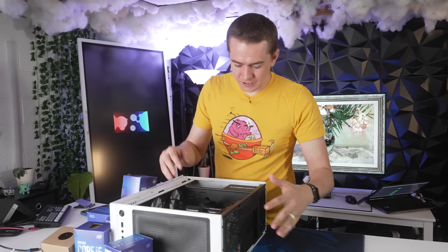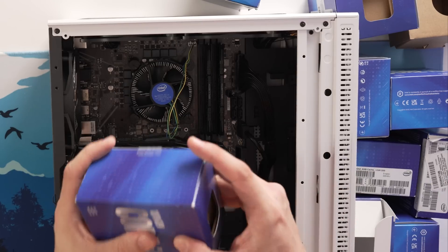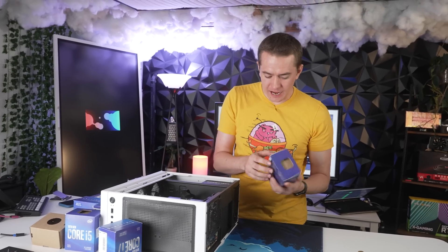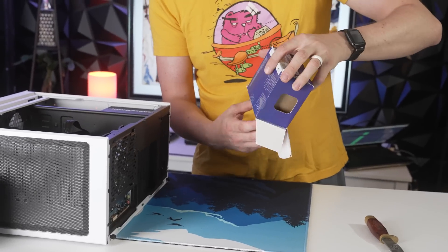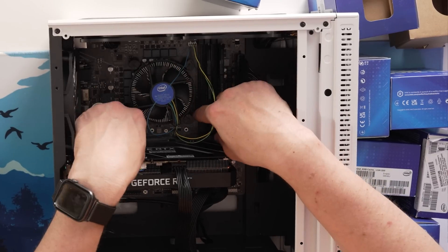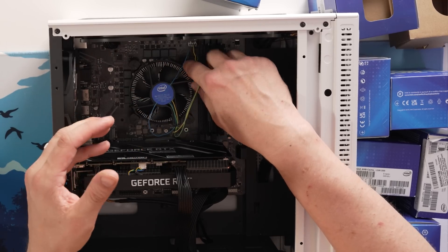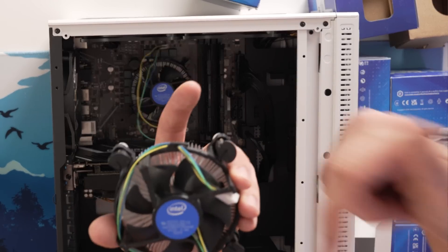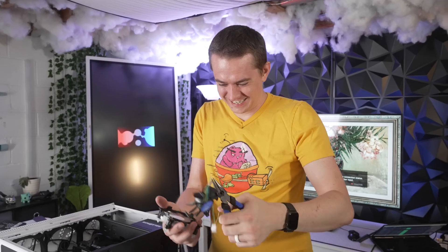The plan is simple enough, but I'm not entirely sure it's going to work. Essentially we have to pop off the top of each cooler and stack the core of the next cooler on top of the core below — that's what the picture indicates. We have to keep the mounting mechanism to hold the cooler to the motherboard, then clip off the fan housing so the fan comes off. The fan will come from the topmost cooler to force air down. I need to keep this ring base on so they contact like that.